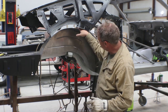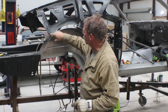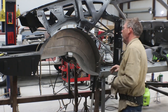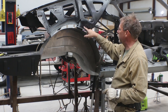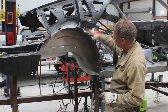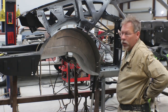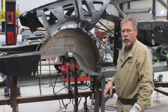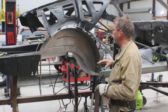What I want is for this wheel tub to come up at least three quarters of an inch in here, so I know we're going to have to trim this piece away to some amount. I still have a piece of the old wheel tub on here, so I need to take this bracket loose completely and get this piece of scrap off of it, so that the wheel tub can come up to the right height. Then I'm going to go get the outer wheel tub and just fit it into place before I do any tacking.